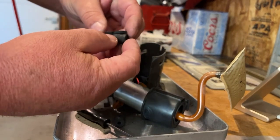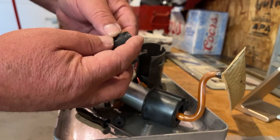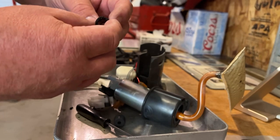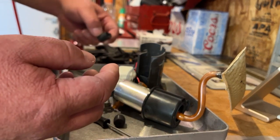This is the seal between the pump and the housing. Ethanol pump gas is what ate this. So use ethanol-free fuel in all of your powersports equipment, weed whackers — that sort of thing.